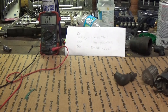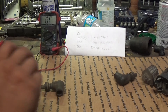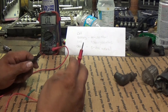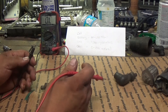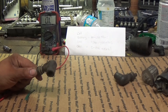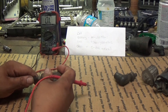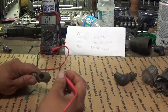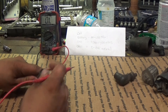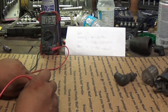You can also test your plug caps — you don't really have to, but I'll show you guys how to do that. Leave it on ohms. Your plug caps should measure between 5000 and 10,000 ohms as your normal range. Take one of your probes and stick it in — this test can be a little picky because you have to get it in there and touch that little contact just right. We're looking for between 5000 and 10,000 ohms. I feel like I got contact right there, and we'll reach in here and touch our metal contact.